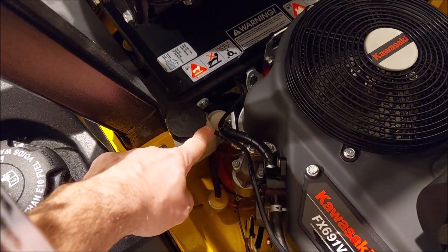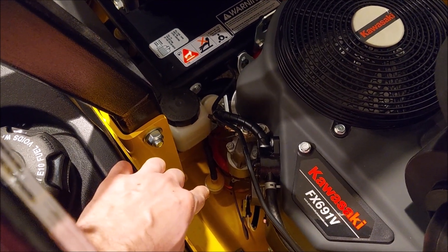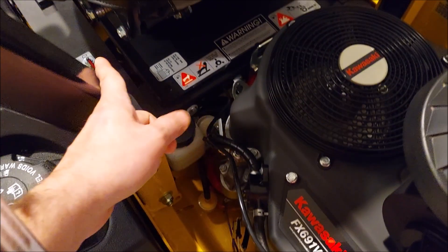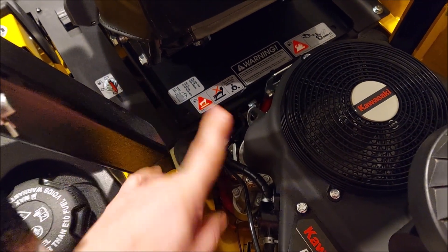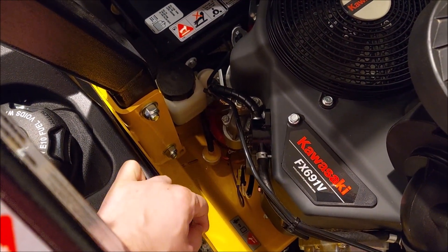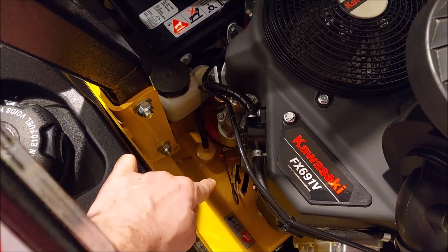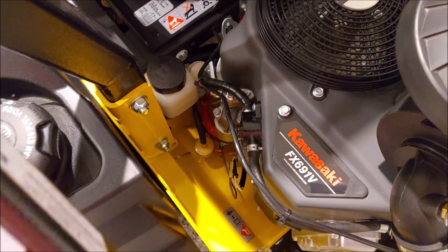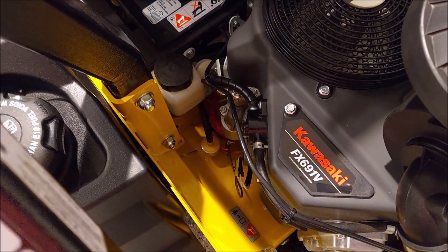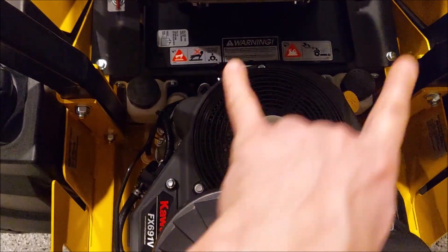There's a fuel filter down there, and there's also one right there — I saw it in a previous video and didn't know what it was. It's actually a breather filter: there's a switch and dual fuel tanks that require a little breather, so they put a cheap fuel filter in a hole in the frame. It just sticks in and drips out the bottom if there's any condensation, and keeps crud from getting up inside. I thought that was a clever little detail.